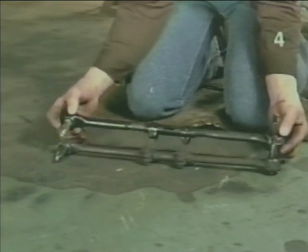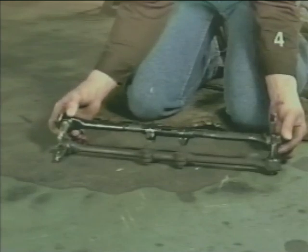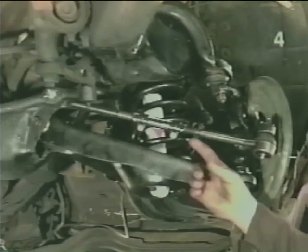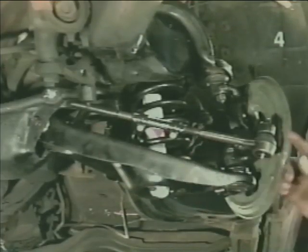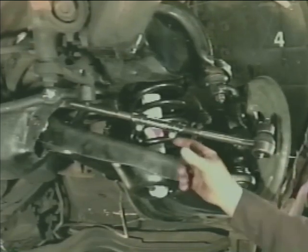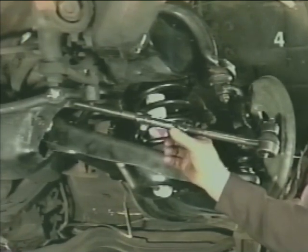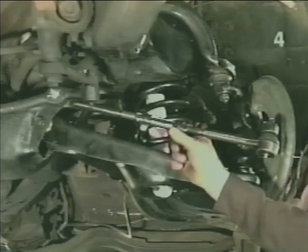Now, we want to lubricate the pins for the tie rods and install our grease fittings and then install the tie rod assembly into the car. With the tie rod assembly installed in the vehicle, final tighten both nuts and install cotter pins. Now is a good time to pre-tighten the locking clamps until they just move snugly about the sleeve.